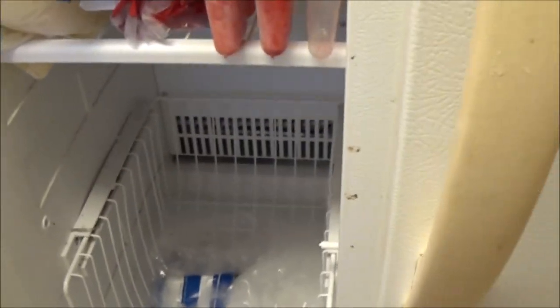I'm going to go ahead and get this yanked out, and then we'll see if we can see anything from the back of there. If not, we'll pull the refrigerator out — it is on wheels — and we'll see if we can't find that drain. You're supposed to clean them drains out once a year. Alright guys, I'll show you what I did: a couple screws, there's one there, one there, two in the back — four all together. So I took the two front screws out so that way this thing could raise up, and it gave me enough room to bring that out.